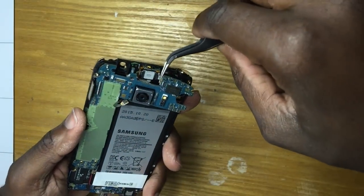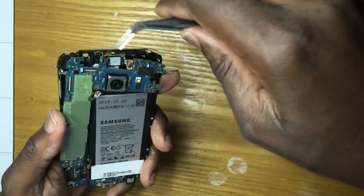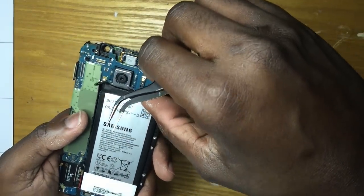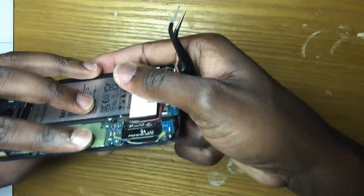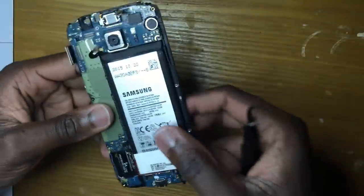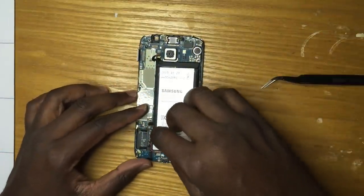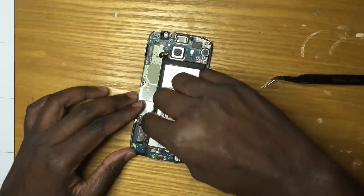It's recommended that you wear gloves. After waiting about 30 minutes to make sure the whole motherboard is dry, I'm putting the logic board back into the phone, making sure that the logic board is completely flush with the phone and that there are no cables in the way. Then go ahead and reconnect all the cables and connectors back to the logic board.